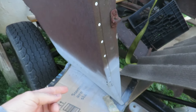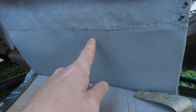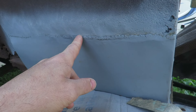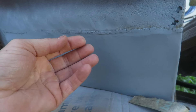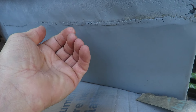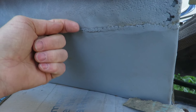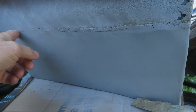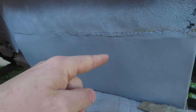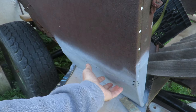I'm going to go ahead and try to re-duplicate this on the other side, except do something a little bit different. For this panel I just did a butt weld onto it, and I think on the other side I'm going to end up trying to do like a lap joint — I think is what they call it — so I'll actually have a piece higher up on the inside and you won't be able to tell it. I'll weld up a seam right here and then on the inside also weld up the top.